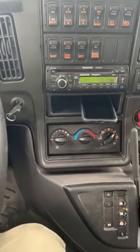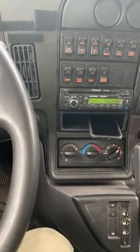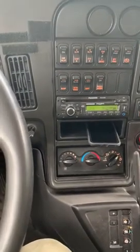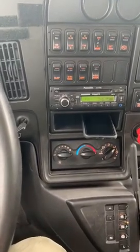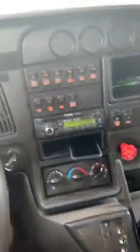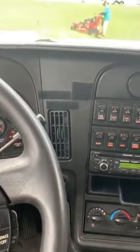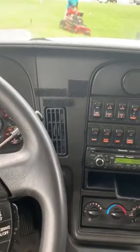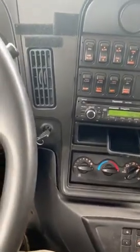My FFT is my fire extinguisher, which is in the storage compartment, and my fire extinguisher should be charged and it should be up to date. My fuses, I should check here to make sure I have extra fuses. And my 3 reflector triangles, they should be in my storage box, and I should have 3 reflective triangles. Now, I'm gonna continue to do my brake test.